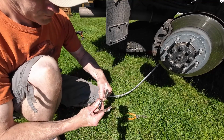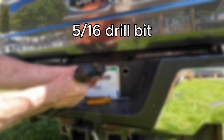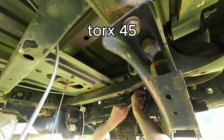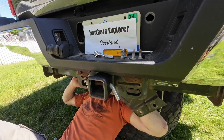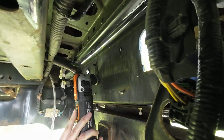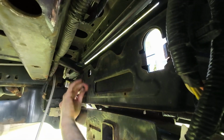I decided to position the Schrader valves where the upper license plate screws would normally be located. These screw holes need to be drilled out in order to fit the valves. The steel backing plate is then removed in order to trim the depth of the holes. After replacing the backing plate, the Schrader valves can then be installed.